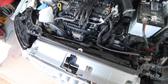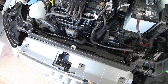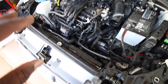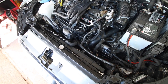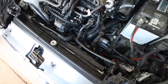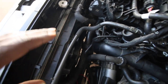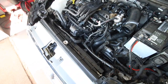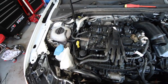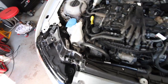I've had a number of suggestions from viewers - thank you for those. On these Audi and VW engines there is a notorious problem with the fan regulators. On the S3 and A3, the fan regulator is actually on the fan itself, so we bought a brand new fan and put that in - but as you heard, it still spins up to full speed. Another suggestion was the pressure temperature gauge for the AC - that's in place and the problem still exists.